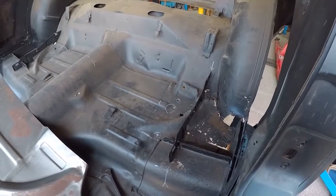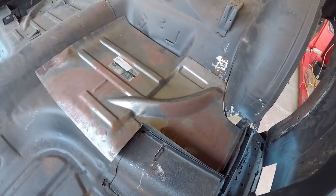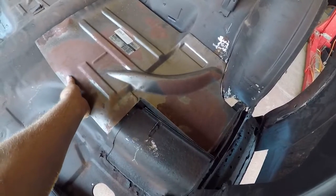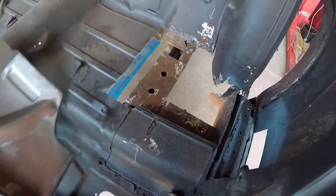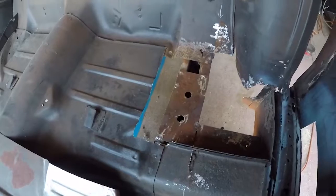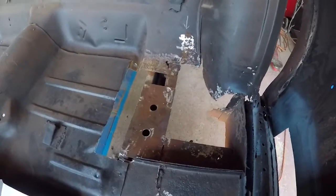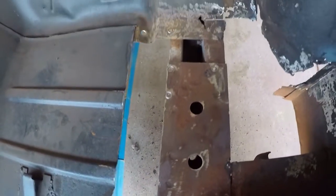Left-hand side, rear, beyond the driver's seat. Now this is the welding panel for the torque box area they talk about at the back of the Mustangs. I've just trimmed it back a little bit so I can get in there, and that's what's below it. I still want to get down in the chassis — inside there's a bit of a repair at the bottom where I'll pull it on with chains. I want to fit that flattened out and fit some plates to it, but other than that it's all very strong within the area.